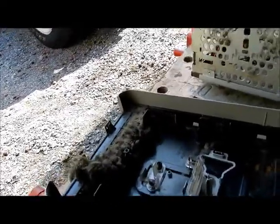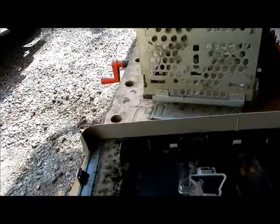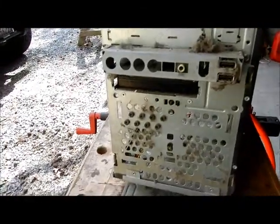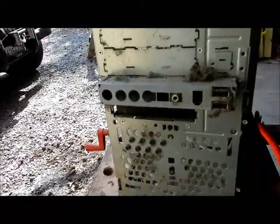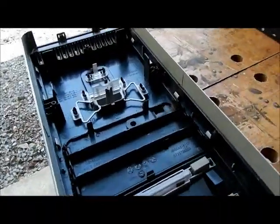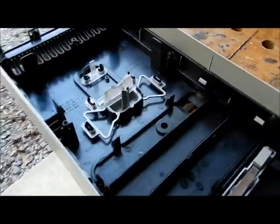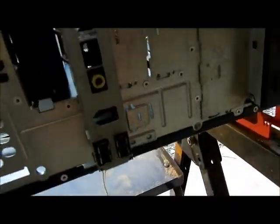The spray cans that you get at the store don't really do the job. For basic cleaning like keyboards, you really need an air compressor to do this. See if a friend has one — you can go to the garage of an automotive shop and use theirs, or a bicycle pump at a gas station. Took three charges of the compressor to get this thing clean. Look how clean that is on the inside now. The front is all clean, including the USB.